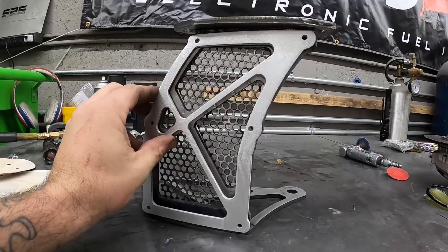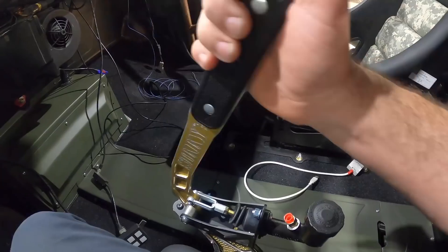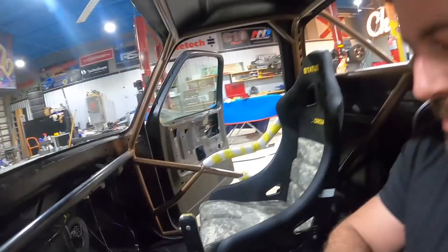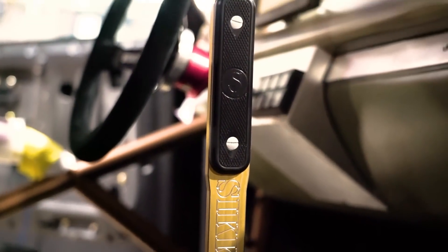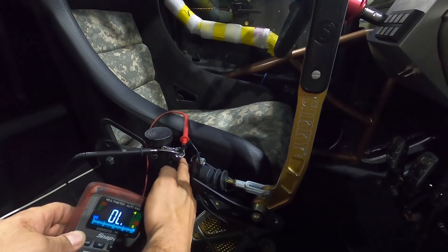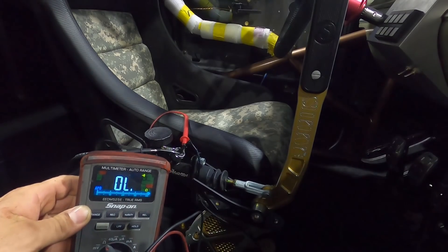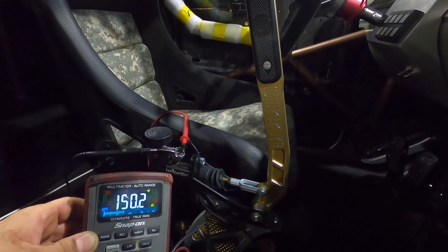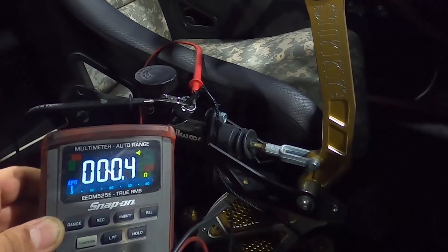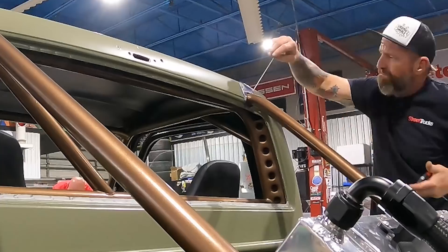You can see it's starting to come together, I think it looks so sick. Now, it's not going to make any hydraulic noises — it's not hydraulically connected to the rear wheels in any way. We're just going to be using it to give a trigger signal for the smart wire to put the Tesla drive unit into full brake regen mode. What that's going to do is basically stop the wheel as we give it that signal. So our hydraulic handbrake is now just an electrical switch — pull back on it and it gives the pressure switch signal. In theory it'll stop the wheels with enough momentum to let the car slide. Now we've got the Sicky handbrake installed and the guys from City Auto Glass are here to put in the windshield and back glass.